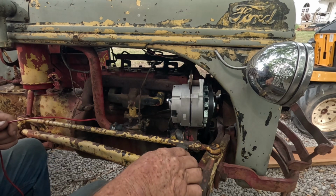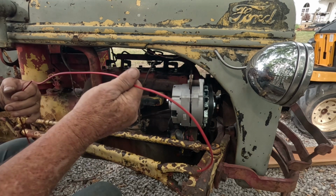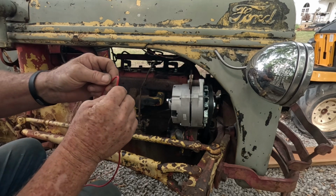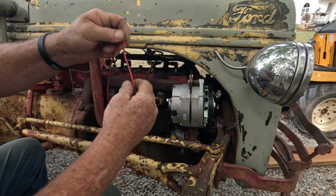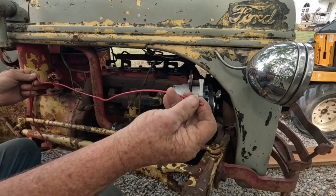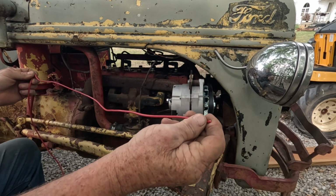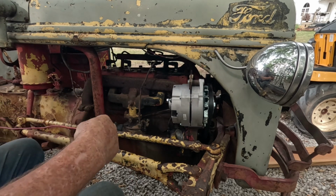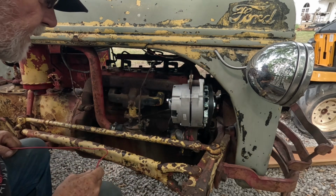But when I got to the starter and I changed sides of the cylinder, or when I got to the amp gauge and changed sides of the tractor, I just put a kink in it so I know where I was at so I could measure to go on down. And I know when I put the fusible link on, that's going to add some more length. So that gets that wire figured out.